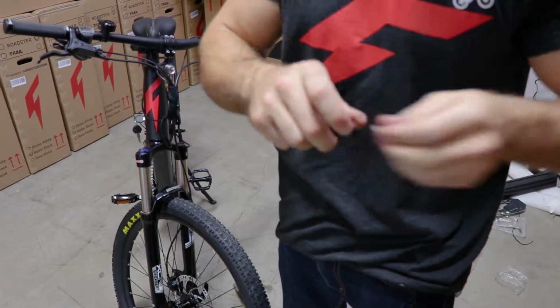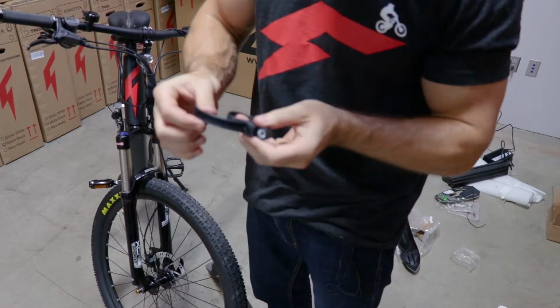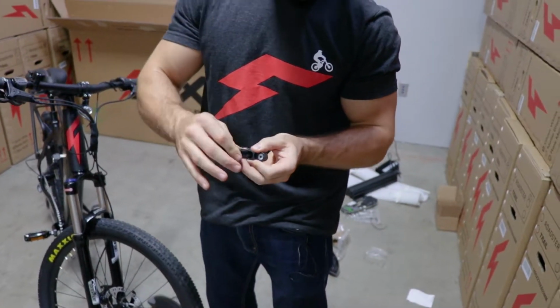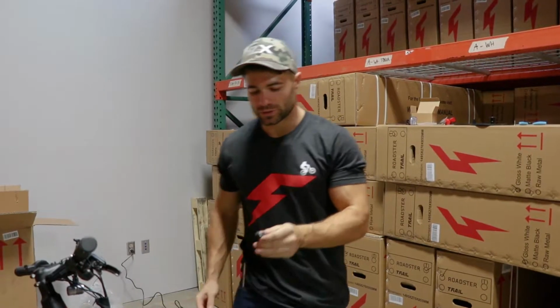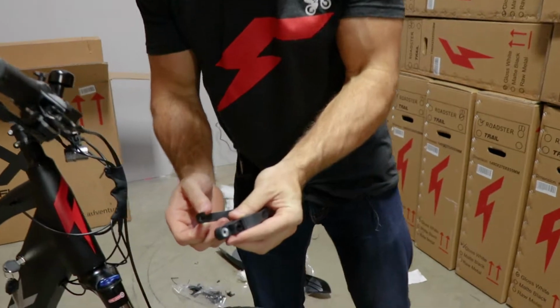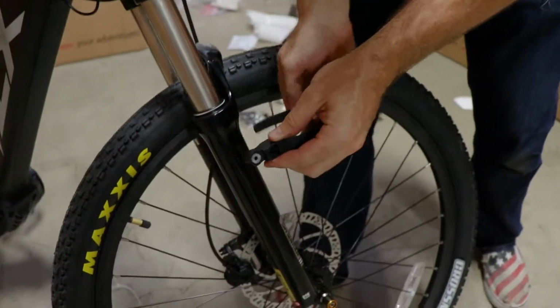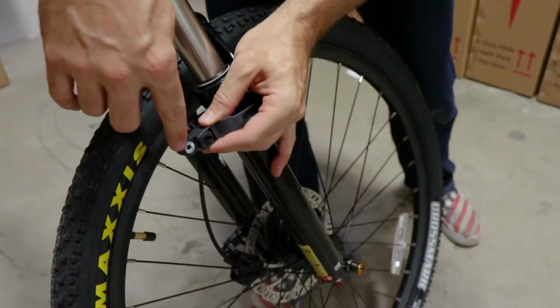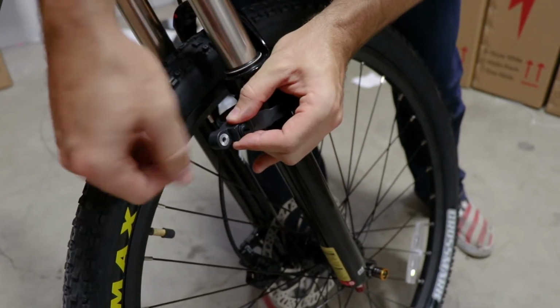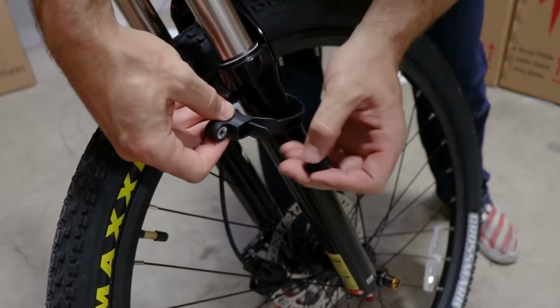And 2, we're going to pull this screw out. So you can just, to get it out, just do that. So to get this front fender on, it's really simple. There's this kind of a pressure clamp. All we're going to do is wrap this, and we want the washer on the back with the teeth facing outwards, because that's where this will mount.